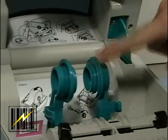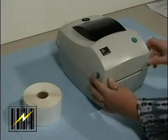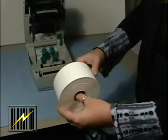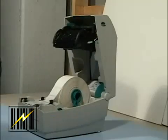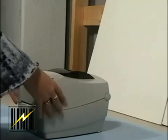Placing the roll in the printer's roll storage compartment. Open the printer by pulling the two green tabs — you need to pull the levers toward the front of the printer. Remove the outside length of media. During shipment, the roll may become dirty when handled or dusty when stored. Removing the outside length avoids dragging adhesive or dirty material between the print head and platen.